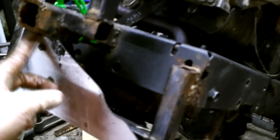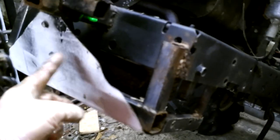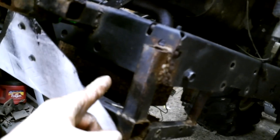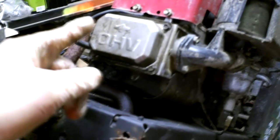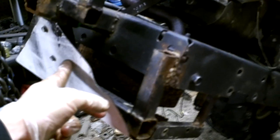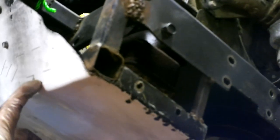I want to show you this while I'm disassembling it — this is my skid plate on the front. A lot of people ask what these bolts are for. There are two bolts here and two bolts on the other side, and the reason is not so I can rebuild it, but so I can remove it. That's because the only way to get the muffler out is to undo that bolt, undo the two on the other side of the engine, and drop the muffler out through. If this were not a removable plate, I could never get it out the bottom and I'd have to lift the whole entire motor out.